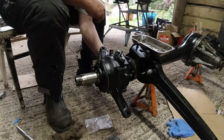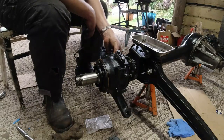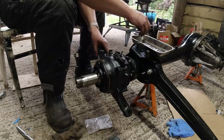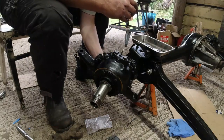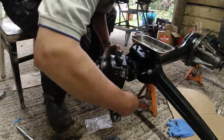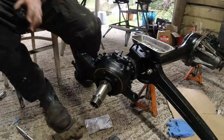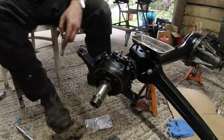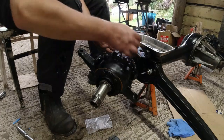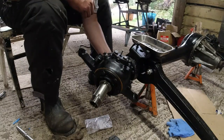Six of these little bolts hold these retaining things on. You can get brand new retainers, but the retainers that came off this axle were fine — I'm using them again. When you're doing up these retaining bolts, I tend to work diagonally opposite to basically get it into place, so I don't have to squeeze the seal in at one place but not another. What I'll find at this point is that once it's all squeezed in, the swivel may well get tighter — but that's why you have to do these things without the sweep seal first. Seven-sixteenths. Just pulling it in gently, pushing the seal into its housing.